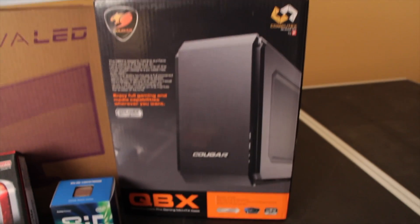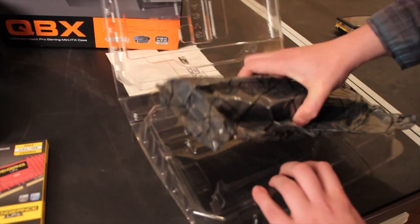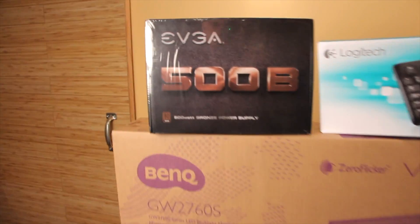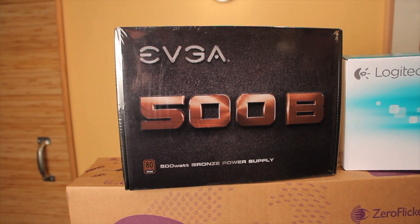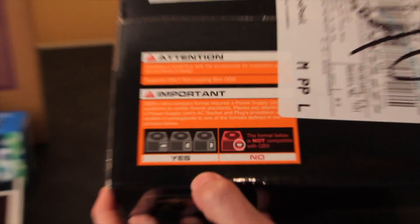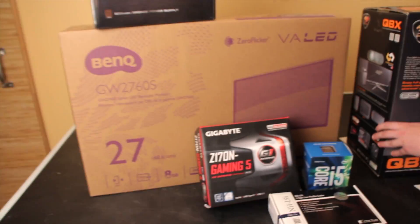Low profile because this is going to be a small box, although you're supposed to be able to cram a full-size GPU in there. My son is determined to put in this old GTX 670 — my very first graphics card. This is the power supply, and what's also cool about this mini ITX case is that it will take an ATX power supply, but you have to make sure the power plug is oriented correctly — there's a warning sticker about orientation.